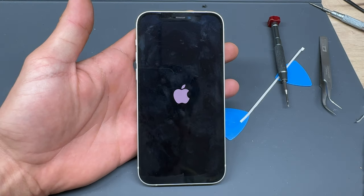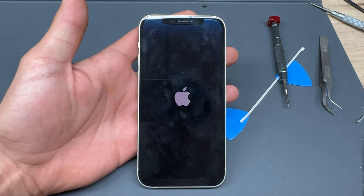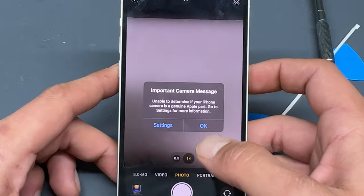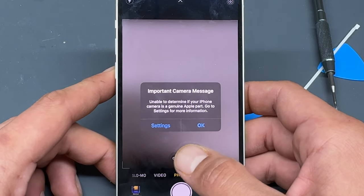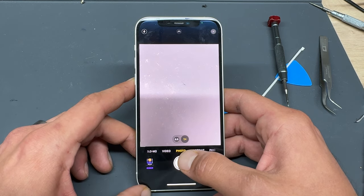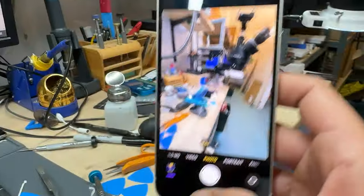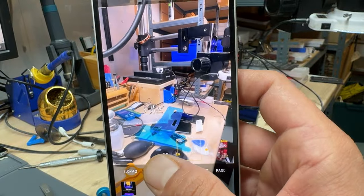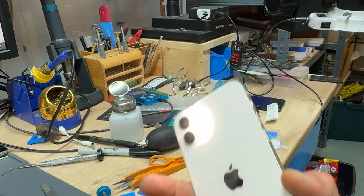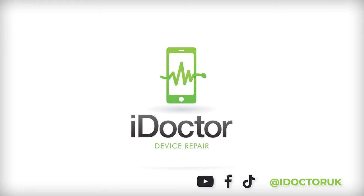Now we can power back on the phone. Don't panic if the phone doesn't turn back on with the button — just try booting it through the charging cable, because sometimes when you disconnect the battery it doesn't always boot straight away. Now we'll open up the camera app and we will get this important camera message. Unfortunately, I don't know a way around this — it's something that you have to live with on models of iPhone 12 onwards. We can see now that we've got the 1x camera and the 2x camera working. Just move it around to confirm it's working, and also check the front camera and flash as well, because they're all related to the same circuits. That's how to replace the camera on the iPhone 12. Thank you for watching and see you next time.